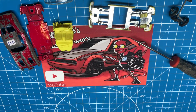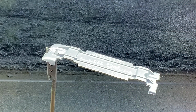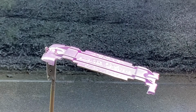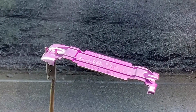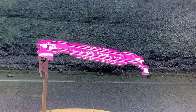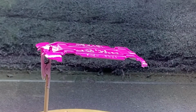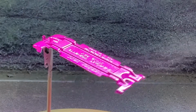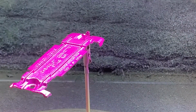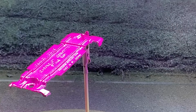Next up, having laid out the parts, I'll strip them all off and get a coat of primer on before going on with the top coats of paint. It's already got a coat of aluminium fine on because I'm using a sparklescent paint on it, and the aluminium fine does give the sparklescent paint a better chance to pop. The colour I'm using is called Sparklescent Porn Star Pink, which I've had sitting on my shelf for an absolute age. I bought it for a different project that never came to be, and I thought the '63 Vette absolutely fits in with the notion of Porn Star Pink.